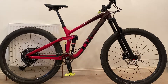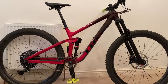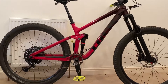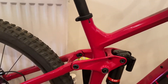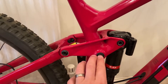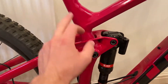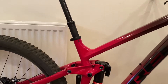I've got a size medium — a 17.5-inch frame in old money. The main negative I've found is that the 125mm dropper isn't a lot of drop. The reason I went medium instead of the ML is because of the kinked seat tube. There's a main pivot on the rocker link that goes through it, and with cable actuation at the bottom, you can only insert the post so far — so you've always got quite a bit of seat post showing.